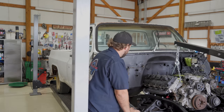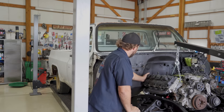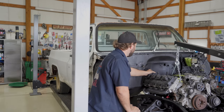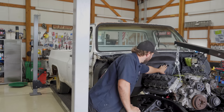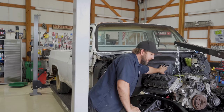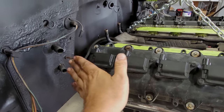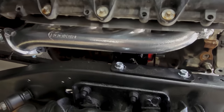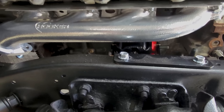The Hemi-half is coming along. The biggest thing I was worried about was the firewall clearance back here, because there's a mess of wiring and heater hoses and doodads, and I think I might bring the Terminator X-Max out through the firewall here where the old AC lines went. Well, just come over here. I'll show you really quick. Now, keep in mind, this might tilt down some once the transmission's in there, but a good indication is the polyurethane isn't stretched out one way or the other.